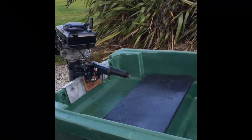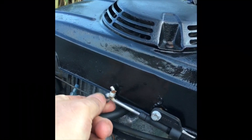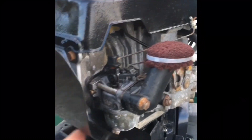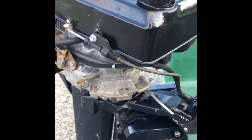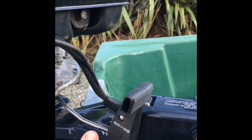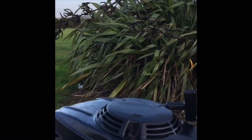Here it is on the back of my little 12-foot plastic boat which is designed to push along. I have a temporary air filter on and I have just used cable ties to connect the accelerator cable with the carb. On the back here I have a splash plate which is just to stop any water being thrown off from the prop onto the exhaust or more importantly onto the spark plug behind. Here we have the gear lever — I've put three little notches along there so that the man using it will know what's where. She's in neutral and off we go.